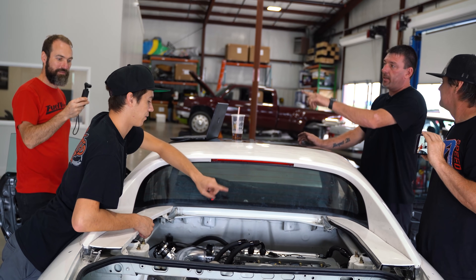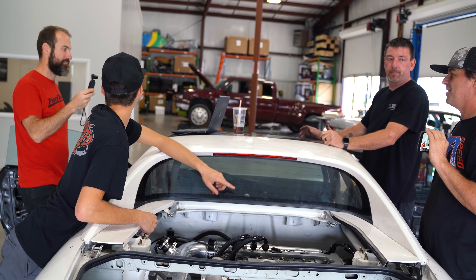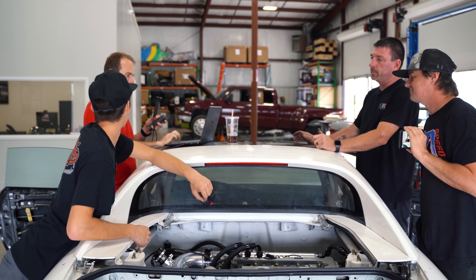So this is another thing — we block the test feature. If you don't have it, then set it up. So if you have something on the map, the injectors will all blow up the engine because they didn't come on. So now back to outputs. They all tested? All of them except for one, so we just gotta trace it down. We have 7 out of 8 injectors working.